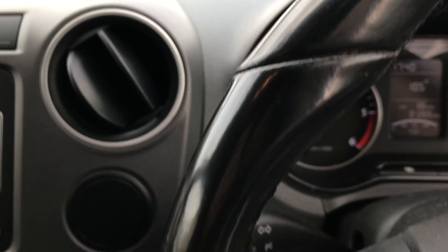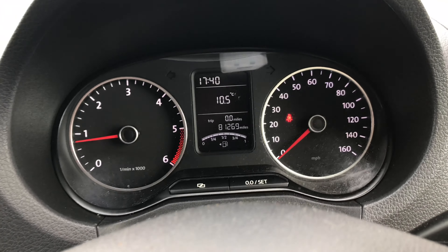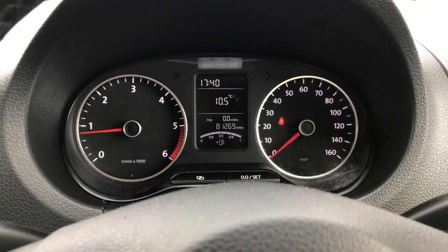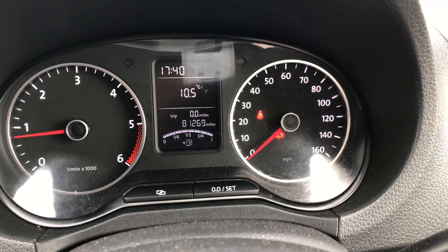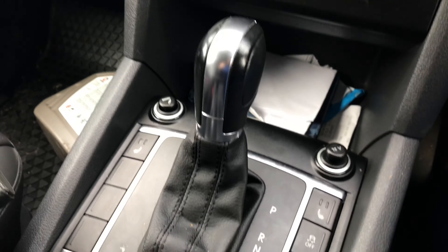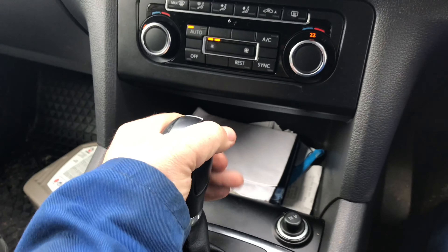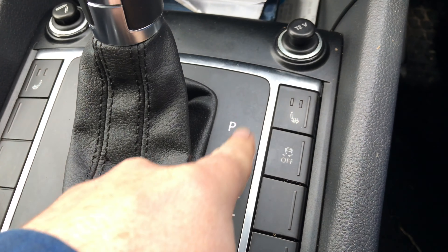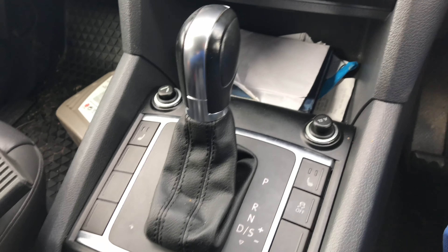The complaint with this thing is - do you see that brake light, do you see that pedal switch? It's flashing there intermittently. The problem is we cannot get this thing out of park. I put my foot on the pedal here and when you go and try and move that, it's stuck. The other thing I noticed, there was no illumination on this panel.